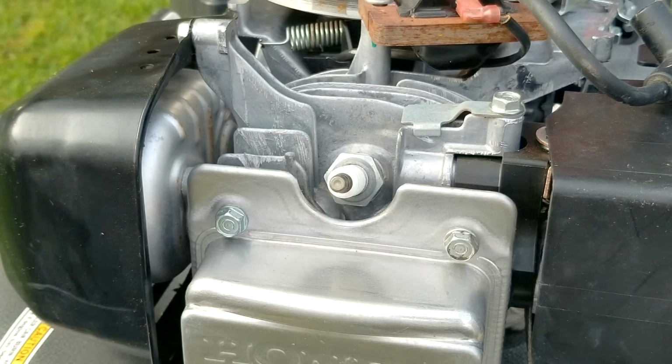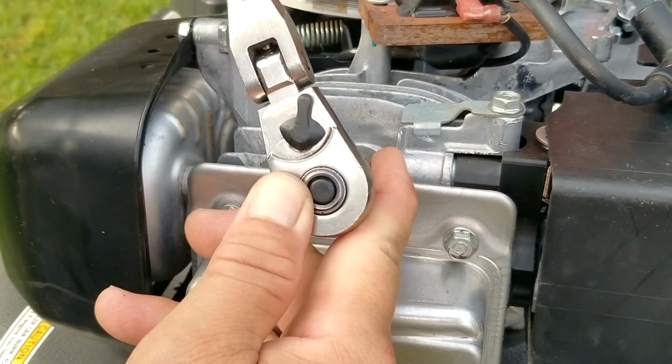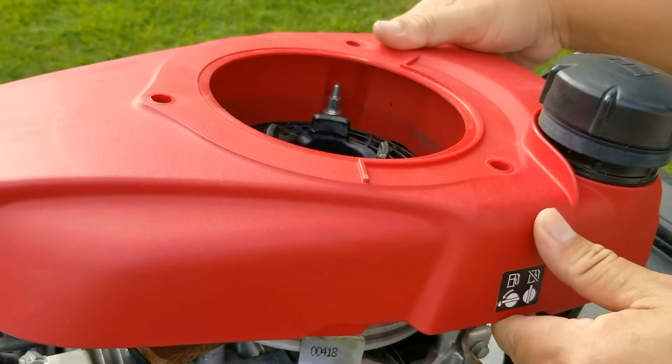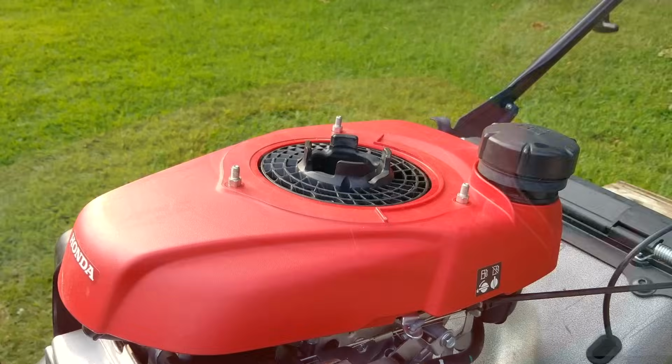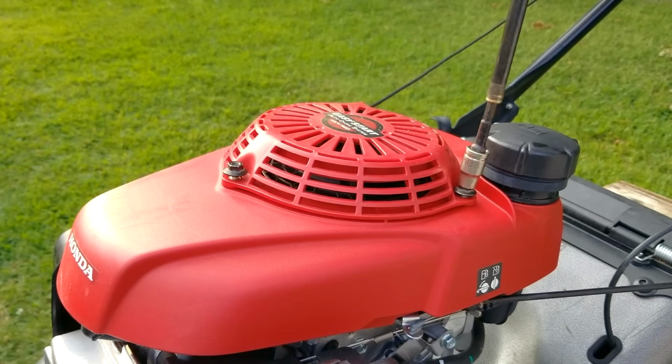The plan is to put everything back onto the engine and then wait for the sealant to partially set up. Now that could take anywhere between 24 and 48 hours depending upon the temperature and humidity before I torque down the bolts. Now I do find this method with the sealant to be quite annoying, so I would definitely consider using a gasket next time.